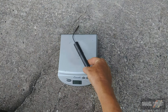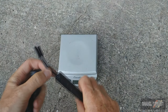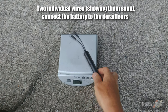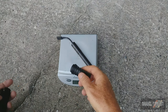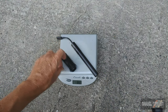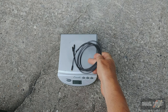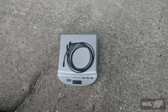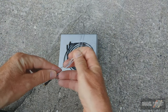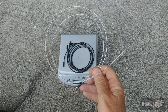This is the internal battery, and it physically connects via two wires to the front and rear derailleur — so it's a semi-wireless system. The front shifters are wireless. The battery weighs 73 grams, or 86 grams with the larger shim for the seat post. Here are the electronic cables to link the derailleurs to the battery — there are three different lengths — and they also include a nice little wire to help you fish the cables through the frame. Only the rear half of the bike is wired; the front half is wireless.